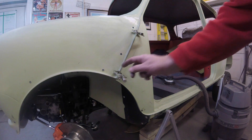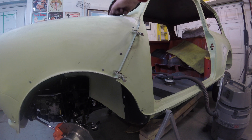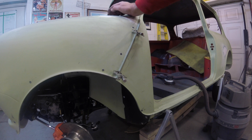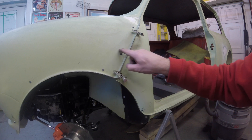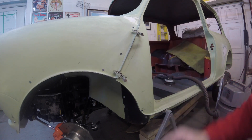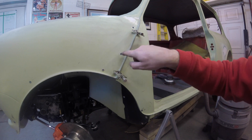The first step is to get your clamps in position — two each side should be enough. The next job is to trim around the scuttle area, which is quite a slow process. Use the carbide-tipped cutting tool and a flap disc — just patiently cut it back to get the right sort of curve. The Archangels front is about half an inch oversized. Once you're fairly happy with the fit around the scuttle and the alignment, the tabs inside should be pre-drilled. You can then mark the holes from the rear side with a pencil and drill your main hole through.